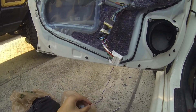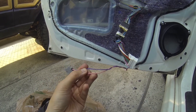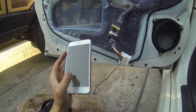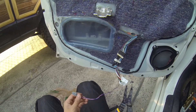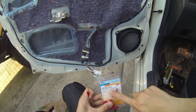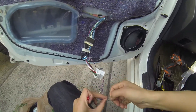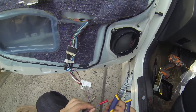Now comes the part where we have to splice this wire and put the butt connector together. Since I didn't buy a harness I wasn't sure which side is positive or negative - pink or purple. I did a quick Google search and for Toyota vehicles it seems like the left front pink is positive and the violet/purple one is negative. I have these amp butt splices from Home Depot for 22 to 18 gauge wire. All you have to do is strip one side of the wire, plug it in, and clamp it down.